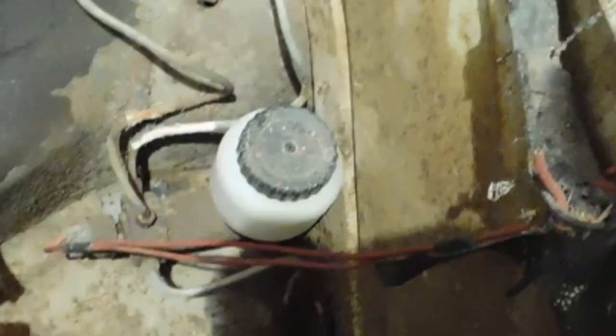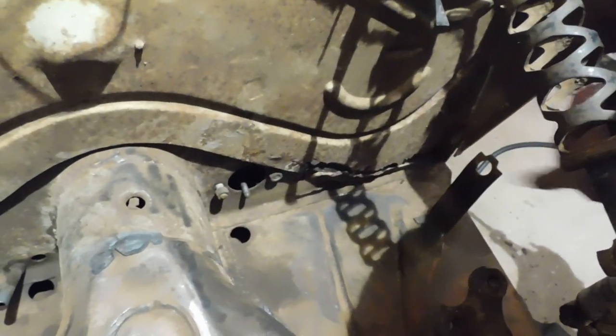Okay, I'm just going over what we did here. I removed the master cylinder that was here. I pulled that out, and all the brake lines that were connected to here. This thing here is where the cable goes to that side, and the line goes over the master cylinder. Same one over there, and both tie rod ends. I pulled out both tie rod ends. Then we cleaned it up, and I'm going to paint it.